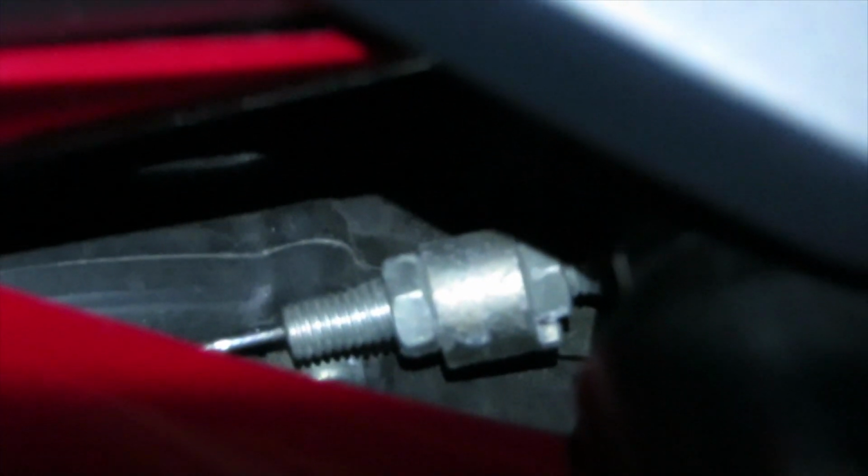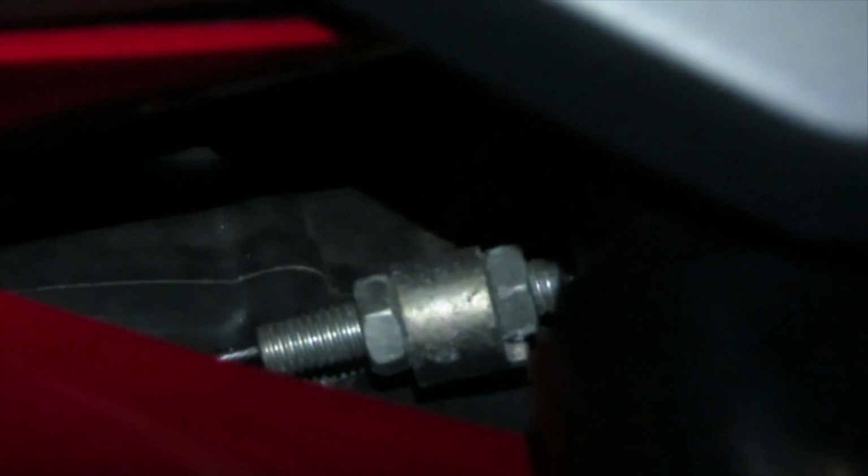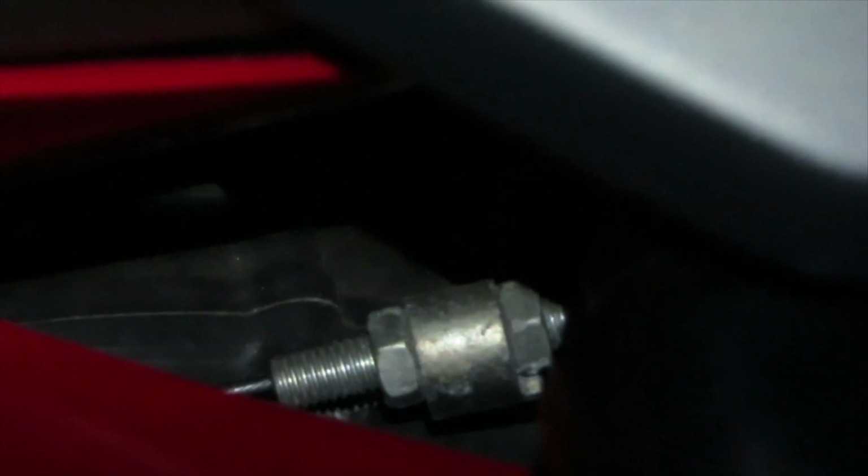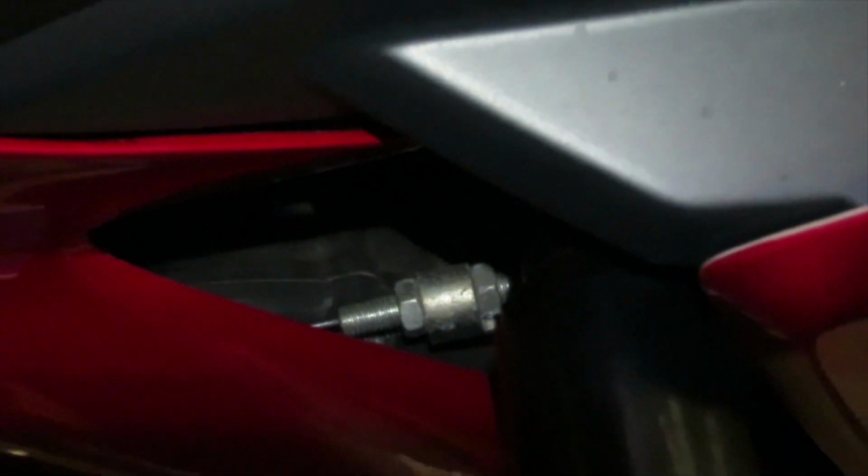You want to make sure that you put the paper towel right in that area, tucked around or underneath, so that when we shoot the cable lubricant, it all goes into the paper towel and not onto your engine. Alright, I'm going to do that, and then I'll show you how it looks. Now I've put the paper towel in there. As you can see, I put it right underneath that section, so that when all the lubricant comes out, it comes out right onto the paper towel.